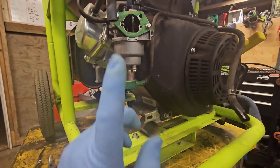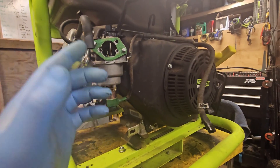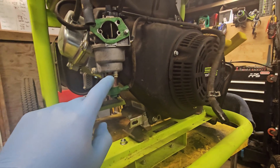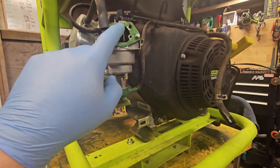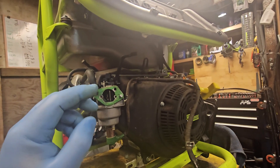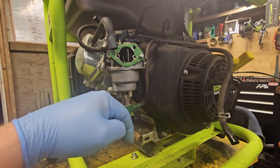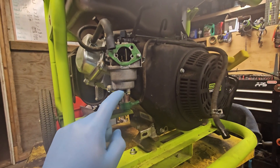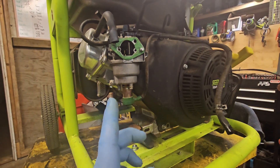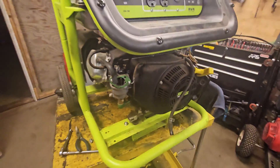The air is still being sucked in, but there's no fuel added to it because this little solenoid shoots up and plugs the hole. When you start it, you pull-start it with the choke on - the choke bypasses the fuel pickup, allowing the engine to start. As soon as the engine starts generating power, within half a second, the power is fed to the solenoid to pull the spring-loaded plunger down, allowing fuel to run up through the jet.